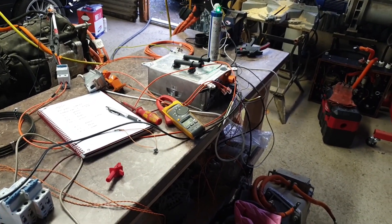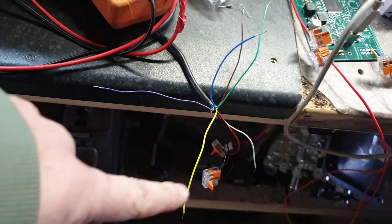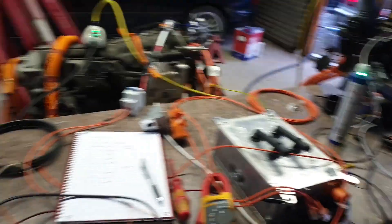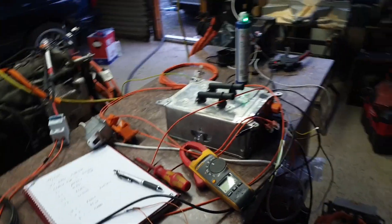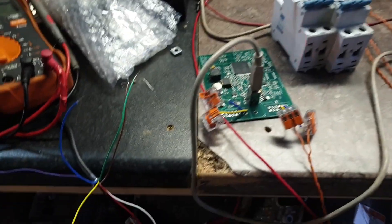So what did we have to do? There were some software and hardware mods. There's a wire here with a resistor hacked in across two of the wires, and those wires go into the multi-pin connector on the front of the charger. The yellow and white wires represent the motor for the charge port flap — not the lock, but the actual cover over the charging port. The other two represent the feedback position for that flap, and I've got a 10k resistor in there simulating that the flap is currently open, which it would need to be for charging.